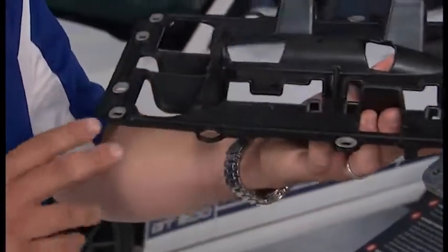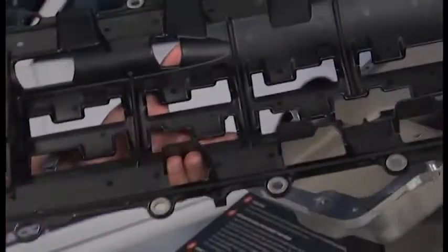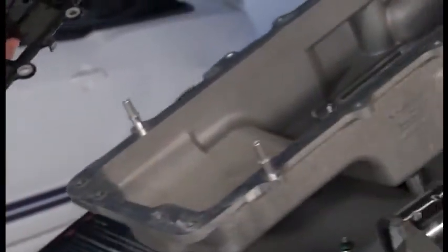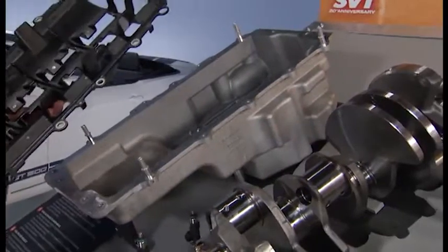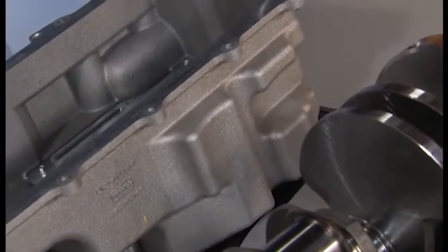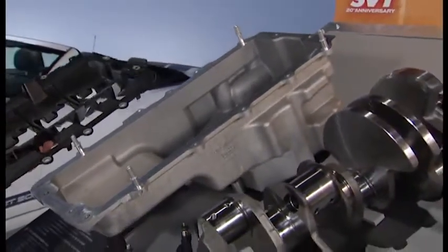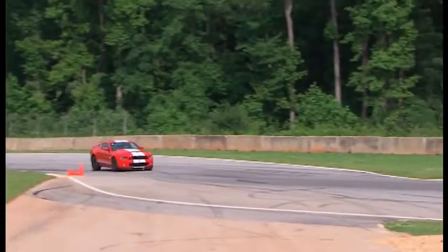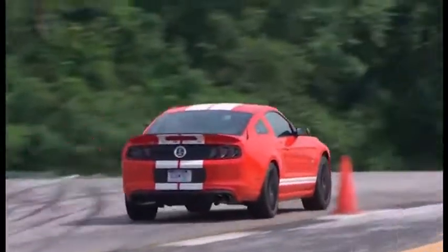This unit is kind of unique in that it's integrated into the oil pan gasket — you can see that the sealing element is molded in on the perimeter of the part. Below it you see here the cast aluminum oil pan with a very unique shape. We took advantage of every bit of package space that we could find below the engine and around the cross member. The reason being that we wanted to increase the volume of the oil so that we could keep it cool — so that when you're generating the tremendous power that we generate for extended periods of time it helps keep that oil in just the right condition for increased durability.